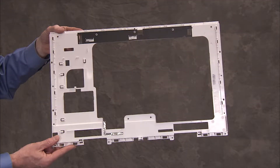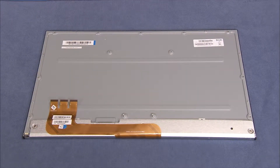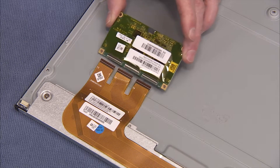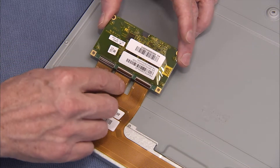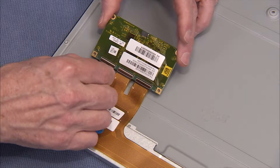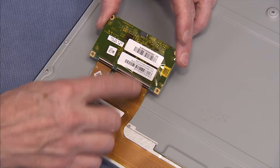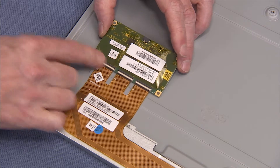To install a new LCD frame or touch panel kit, place the LCD panel face down on a soft, flat surface. Connect the flat connectors to the reserved touch control board and secure with their latches before pressing the touch control board adhesive onto the rear of the panel.